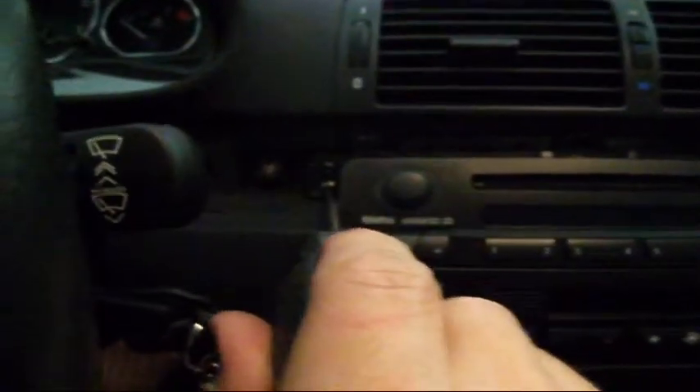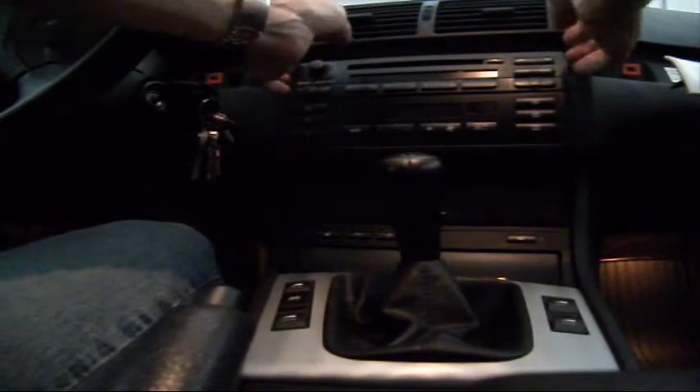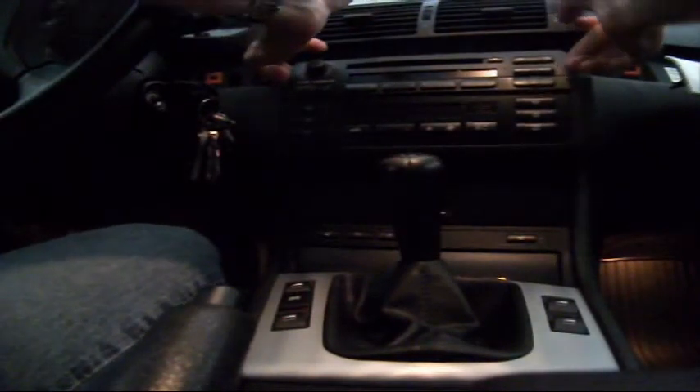You can see here this pin is fairly long, so it's going to take some pulling out. Next thing you want to do, you can turn off your car. You need to take a Phillips screwdriver. You've got one screw there that we undo, and another screw here that we undo. And once that is undone, this thing should just fall right out. Take this from each side here and just wiggle the thing — it will come out like that.